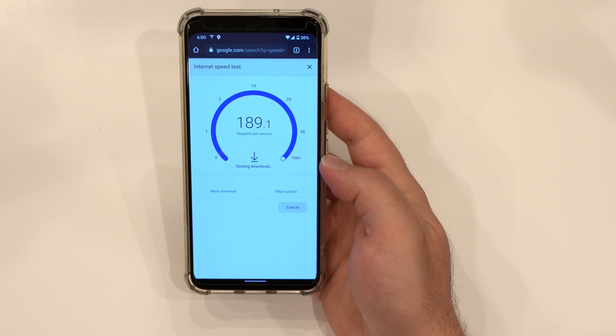You're not going to get that full speed with the Wi-Fi point. The point is very convenient because you don't need an ethernet connection — just plug it into the wall with the power cable and you're done. One thing about the Google Nest Wi-Fi is that you almost need a switch, because there's literally only one ethernet output on this thing. If you have multiple wired devices, you'll need a switch. Devices like the Netgear Orbi have around four outputs, so you might get away without a switch.